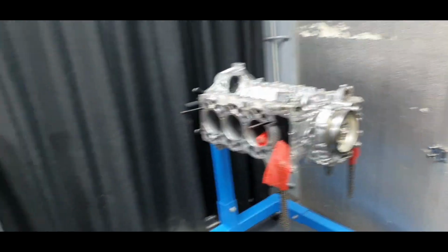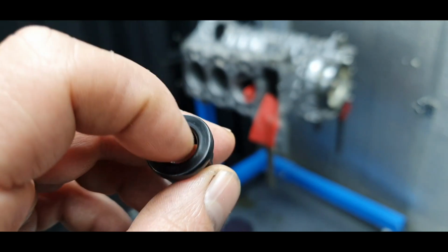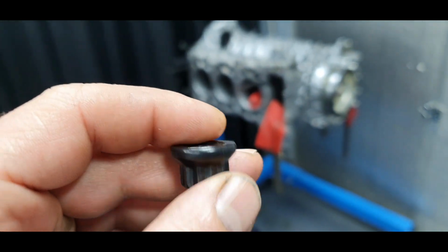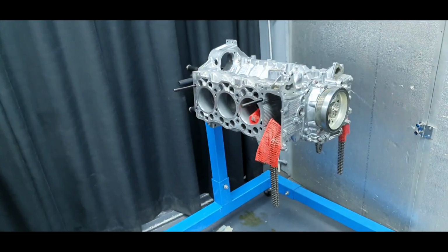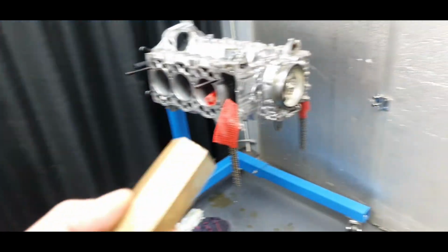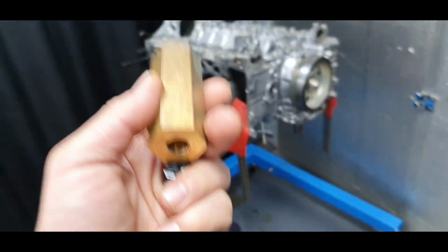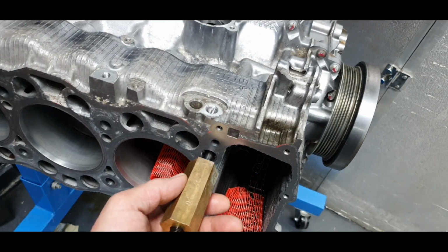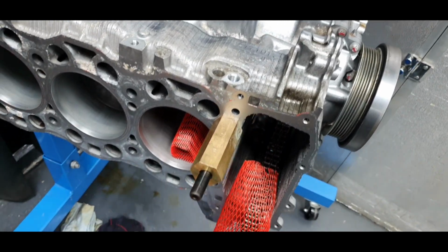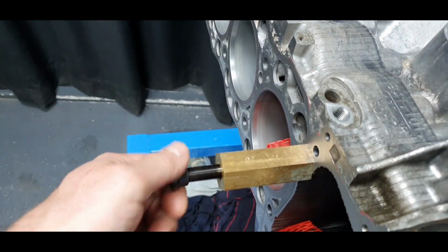So today I did something. Yesterday I didn't calculate the fact that the washer here, after the threads, there is a washer on the nut. It's not like that. Let me show you what I'm trying to say. This is 72.2 millimeters, the height of the cylinder head, alright? So I'm inserting it inside without the head gasket. Forget the head gasket, forget the washer that comes after the nut.